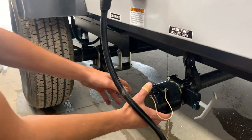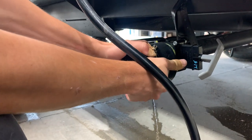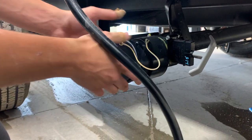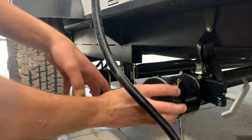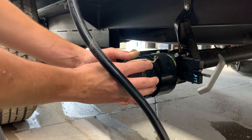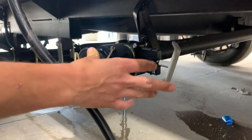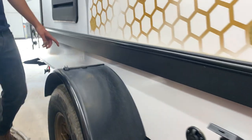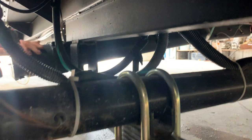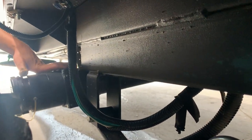You've got your main sewer outlet right here. Just give it a twist and it pops right off. Take note of those two ears — there are the same two ears that your sewer hose has and they just hook up like so. This is going to be your gray tank, so it'll be cleaner water. You are going to want to empty your black tank, which is in front of the tire, first — that's your dirtiest water from the toilet. Empty that first just to keep the hose a little bit cleaner.